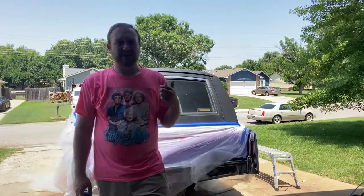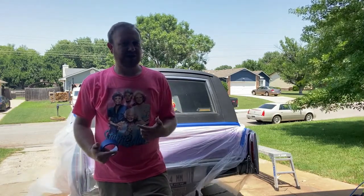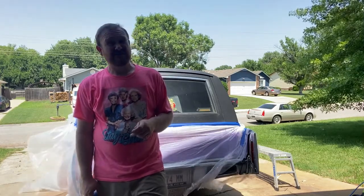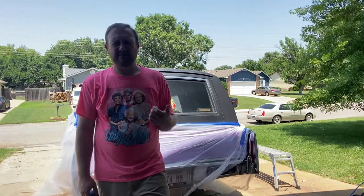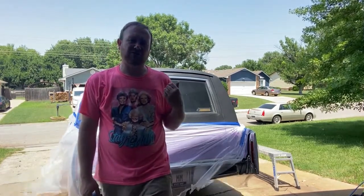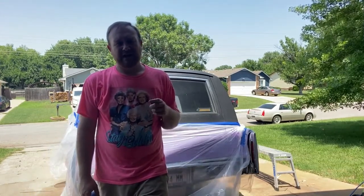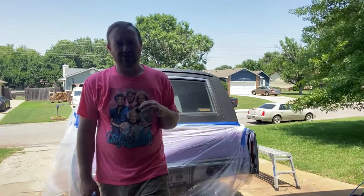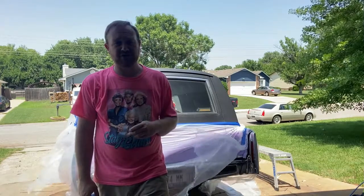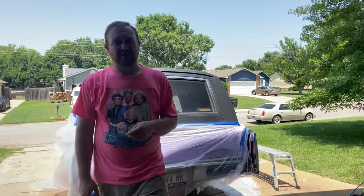But today on the top, like we've done before, we're going to use Duplicolor. Comes in the quart cans, just going to be jet black, and I think it was like $25 a quart or something like that. It's the same paint that I used. If some of you have seen the Car Wizard where the car was satin black, that is the same paint that I used, and I think I used maybe 2.5 quarts to paint this entire car. It's ready to spray, there's no mixing, it's ready to go right off the shelf. Super easy, comes in a lot of different colors, really easy to spray.